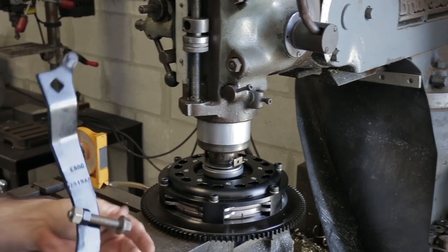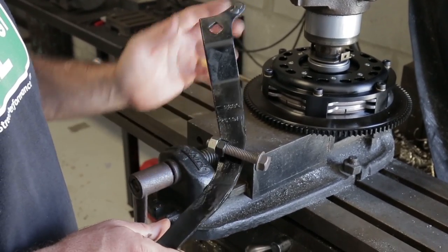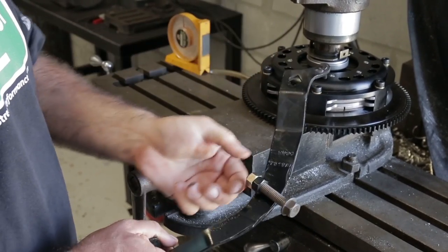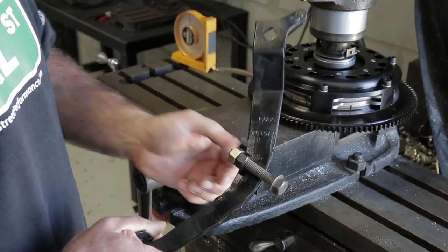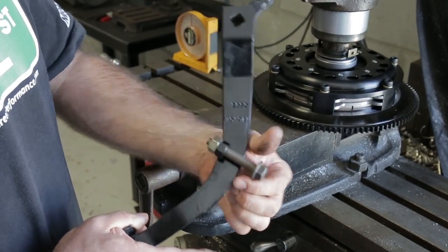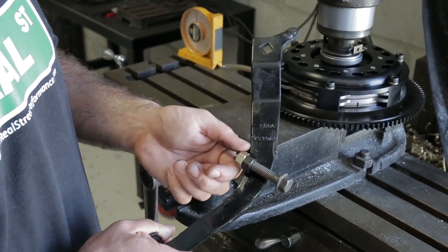Here's an inexpensive approach: I've welded a nut to the clutch pedal and another nut to lock it down, then we just adjust our pedal height with a bolt. Once we get a quarter inch past where the floater rings — you can hear it ring like a bell — we lock the nut down.